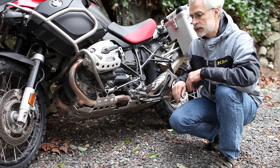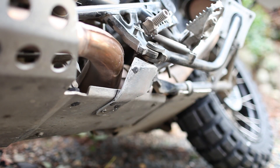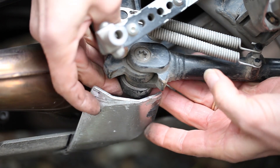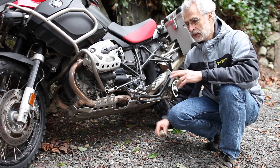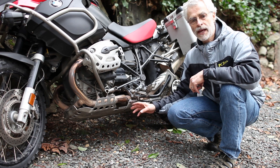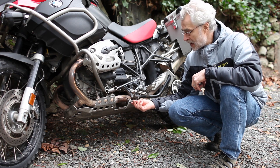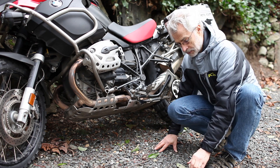All you need to do is flip off your sidestand and off you go. Well, I've had rocks coming flying and breaking this switch here, and that's why I made this little protection plate here. I want to have the disclaimer out there — I'm not an engineer, I'm a photographer, a motorcycle traveler — but you learn a little as you go. This is a very crude thing I put together of about a two millimeter aluminum plate, bolting it to the sump plate, the Touratech plate here, and just bent it around. I hope that's going to do the job.